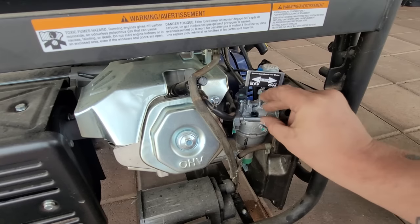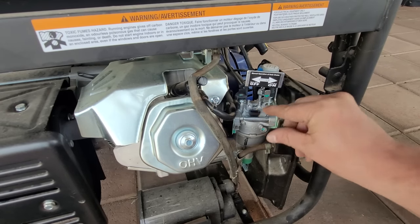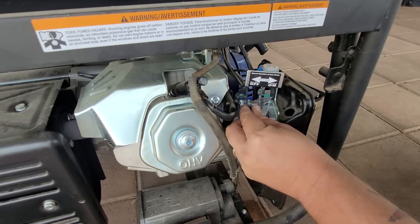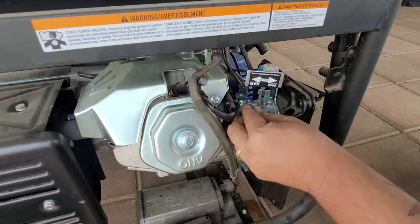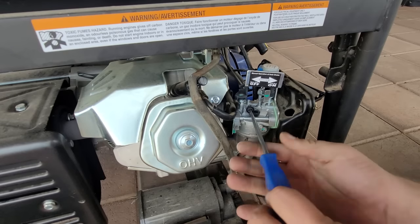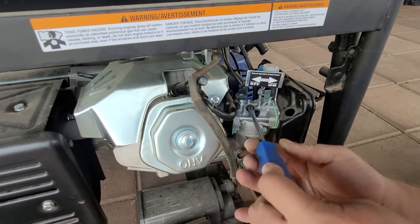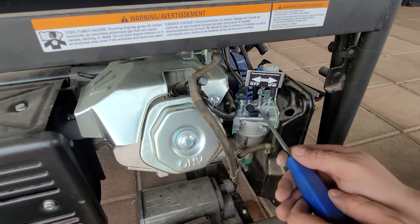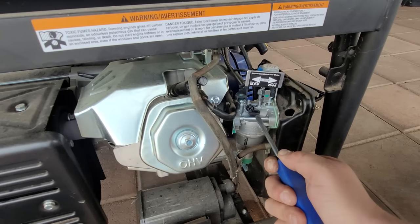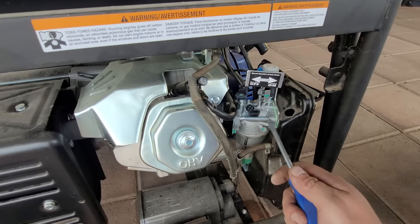Now go ahead and put that back in, just press it down. Put the extra cap back on there, then put the idle back in. Most of the time on these you will adjust it afterwards, so we'll adjust it after we try to start this thing. The main reason it surges is because of this pilot idle jet right here, and this is pretty standard on most newer carburetors nowadays — 90% of the carburetors you're working on have this.